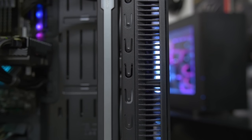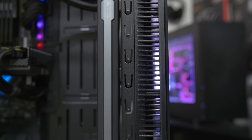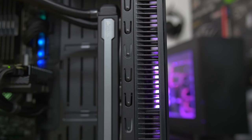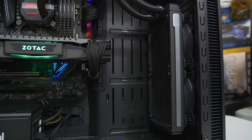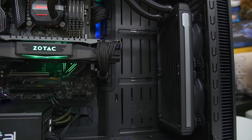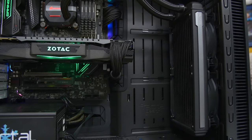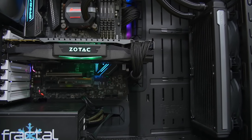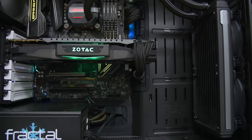We're going to find out whether or not it makes a difference today. On the other side of the argument, if you have a front-mounted radiator set to intake, you're pulling cool fresh air from your ambient surrounding environment, which is generally cooler than the warm air circulating inside your case — so that's good for CPU temperatures. At the same time, once that cool fresh air permeates the fin stack, it carries away all the heat absorbed in that array and ejects it inside your case, so you're potentially getting warmer components like your graphics card, which in most mid-tower chassis is mounted right in front of a front-mounted radiator.